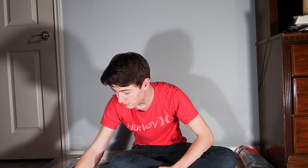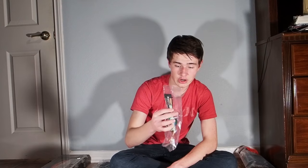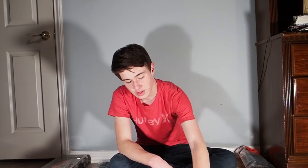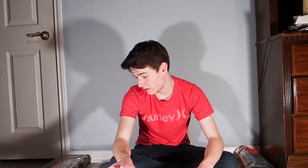This is our new head unit, right here. With that new head unit came several things. We had a microphone, a generic wiring harness, two USB cables. I don't exactly know what those are going to be used for yet, probably some connection to the system USB drive. Installation screws, installation and removal keys, and this trim plate. That was everything that came with this head unit.